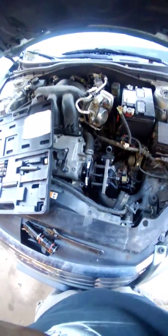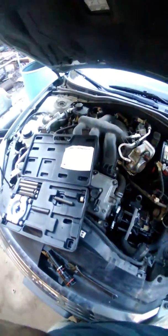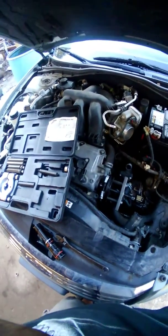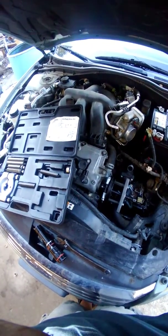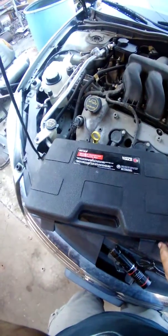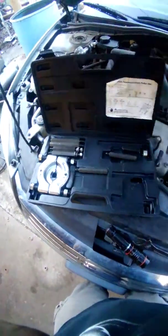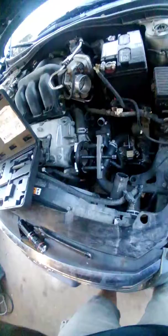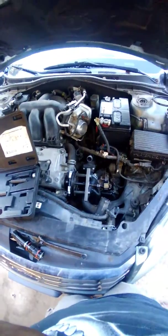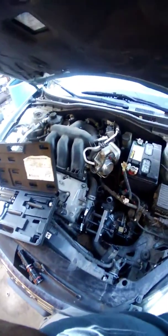You can, of course, buy another tool, spend another $100 or $200 for that tool if you're doing this quite frequently. Or I thought maybe you could just use tools you may have already in the box. This is a bearing separator — Matco push-puller set, actually. And believe it or not, it fits right through this pulley and pulled it right off. We're just saving a dollar — use some tools you got in your toolbox already.